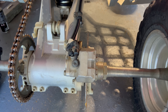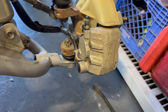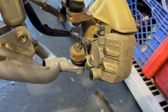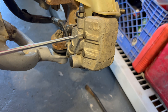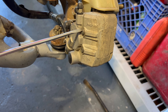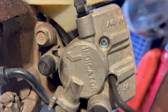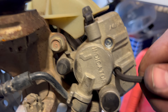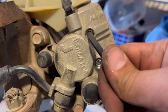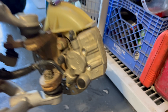Now let's move on to the front. Come to your front caliper — this is your front caliper right here. Just like the rears, you want to crack these two flathead screwdriver bolts right here loose, and that's going to give you access to an allen key. Take these off and you'll have access to the allen bolts — this one and this one. Crack those loose; these are what's holding the pad, so crack those before you loosen up the caliper itself.